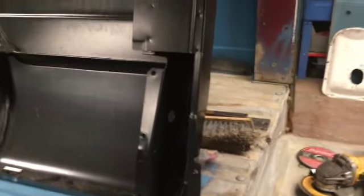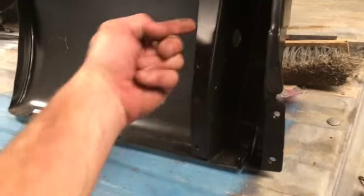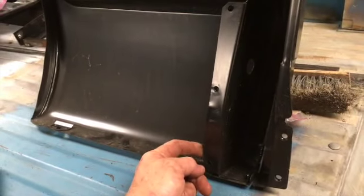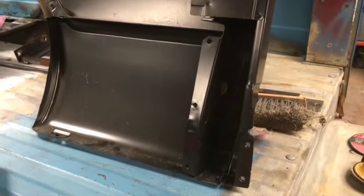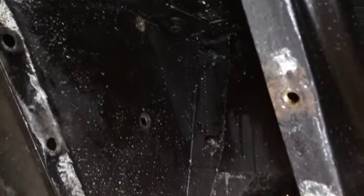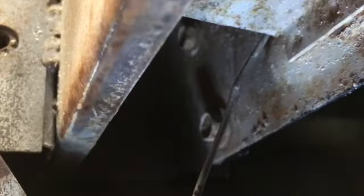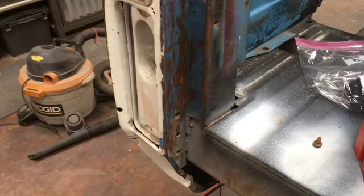All right, so here's the new panel. These are the ones that were taken loose, and the nuts are welded on those, on all three of them. So they'll go from inside that stiffening box outward on this new panel. All right, we got those three out. That leaves the two in the back. All right, yep, there's the two in the back that need to come out yet. Both of them half inch nut and bolt.